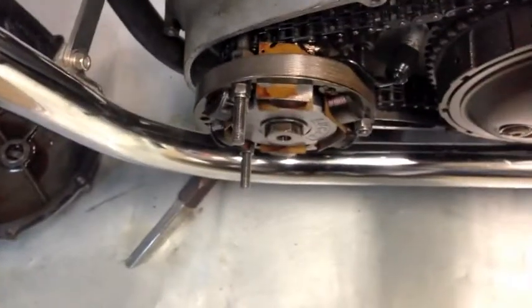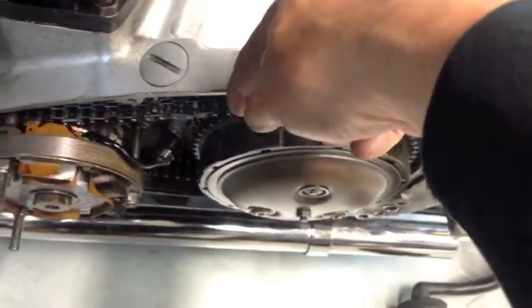But anyway, go pull that off, and I stick a razor blade. Once I get it to start to come off, I keep the razor blade on the back side of it and I work along. It takes it off without ruining the gasket, so I can save the gasket. And put the oil pan underneath, because once you crack those bolts, all that stuff is going to start dripping out.